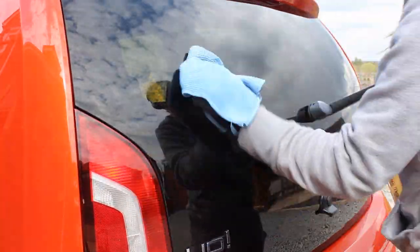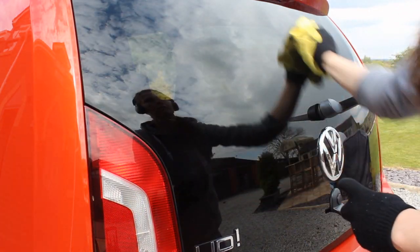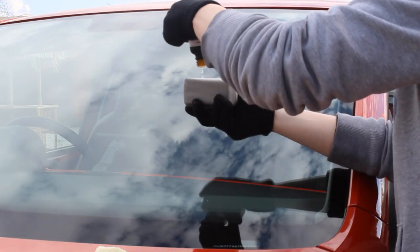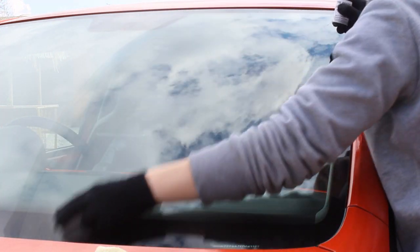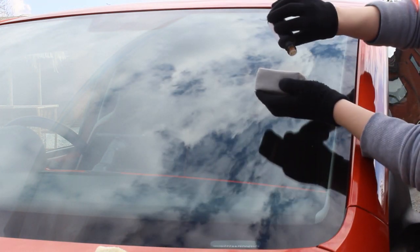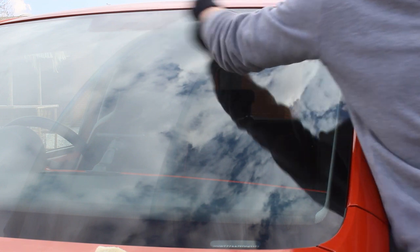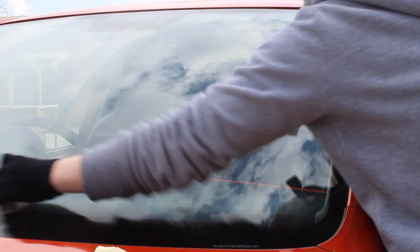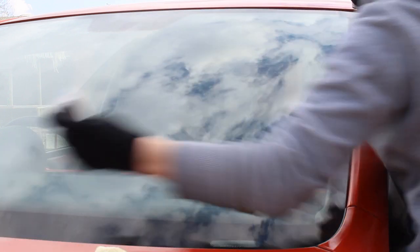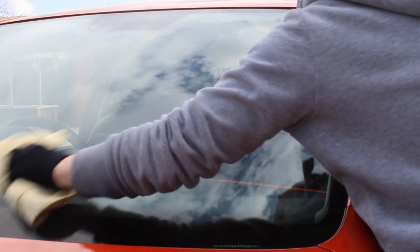I also wanted to apply some protection to the glass, so I continued the prep process using a water spot remover by Tac Systems, followed by a panel wipe solution by Car Can. On the windshield I went for the Pyramid Car Care Glass Coating as it's probably the most durable one I have in my collection. The application process is very straightforward — it comes with an applicator pad, you add a few drops and spread it in a crosshatch pattern. On a windshield this size I worked in three sections. Fifteen seconds after applying, you level it using really light pressure with a microfiber towel.